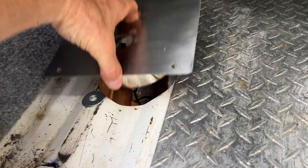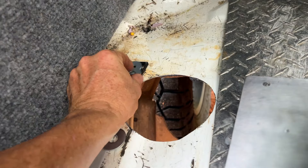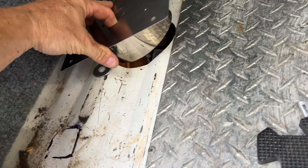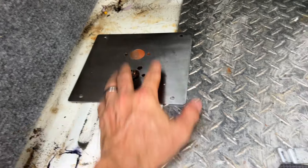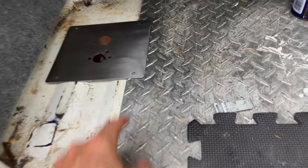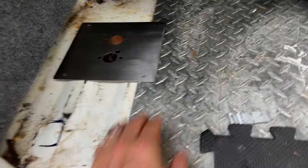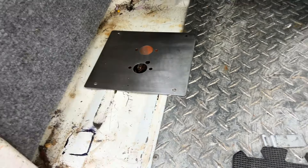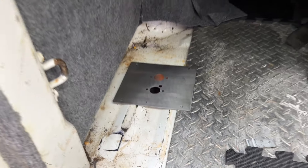So I had a little issue. I basically found this — it's a magnet with a hole in it, and I got some washers to put on it. I'm going to put a washer here and just line those holes up so when I screw it, it kind of stabilizes it. Most people are not going to have that issue. I could cut this out, but I don't want to — I'd have to drag a grinder out and everything. This is a little loose, but once I put a couple screws through here to the bed, it's going to stabilize it good. So that's nice and level, and I think we're going to be good with that.